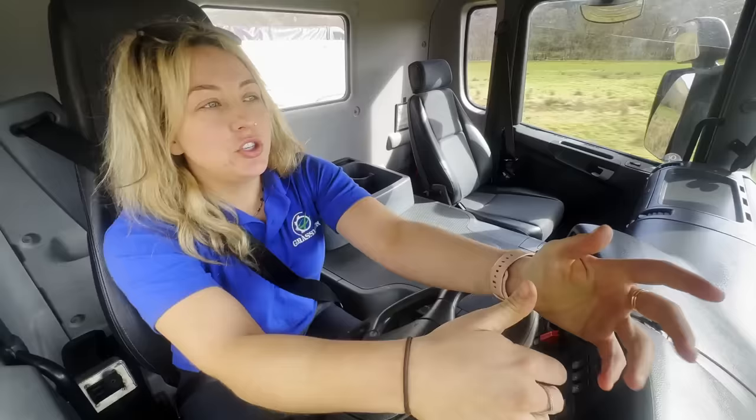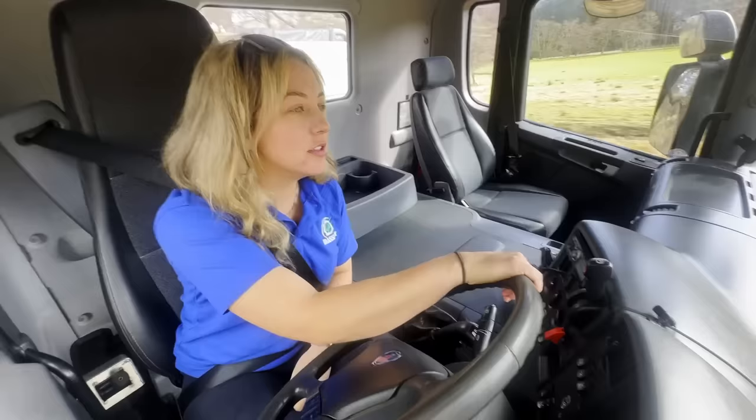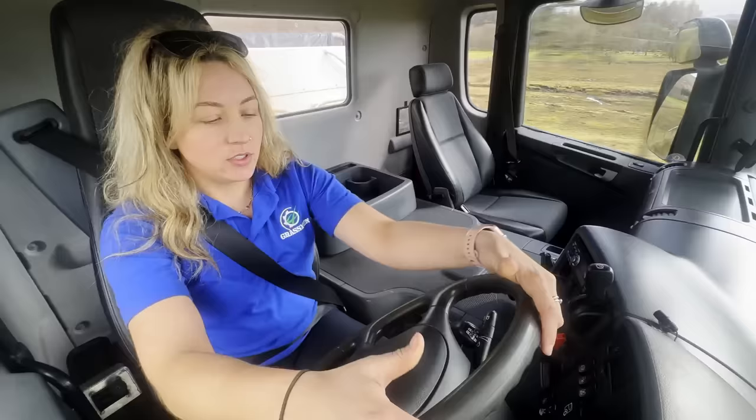With the manuals you can obviously, if I'm empty, just start in second gear and skip a few gears - go second to fourth or one through three to five. You can skip out a few gears depending on how much weight you've got in the back. Whereas an automatic is always going up through the gears. Even though our six-wheeler is automatic, I do have it in manual quite a lot when loaded because it just changes at the wrong time on hills. You could find yourself in a tricky situation.